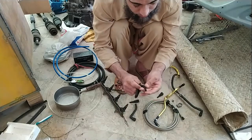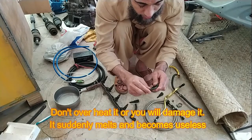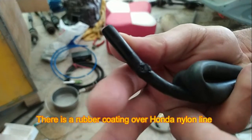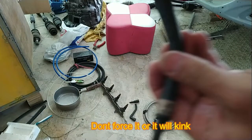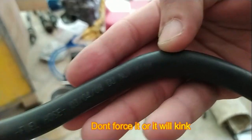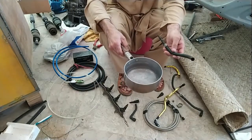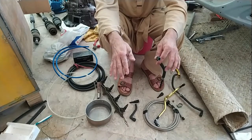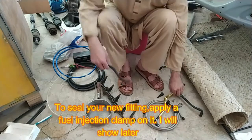Be very careful because the inside is hard nylon — it's very easy to kink. If you overheat it, it will swell and become useless. It is clearly written on the hose: 'do not kink.' To soften it, use boiling water — just dip it. Or you can use a lighter or heat gun, but do that away from the car because fuel and fire are not a good combination.